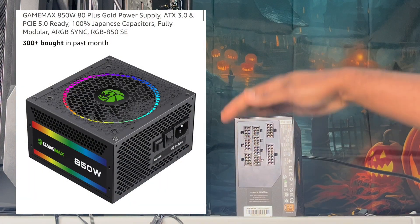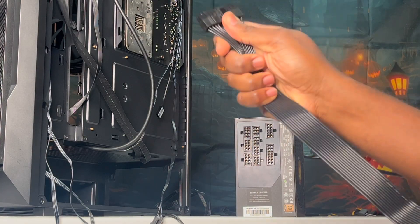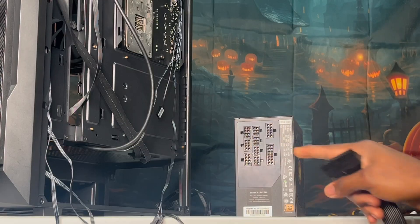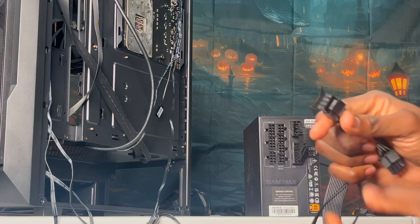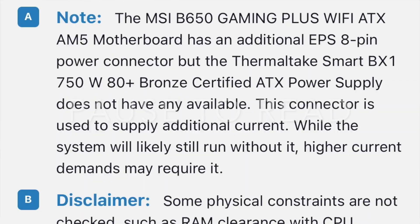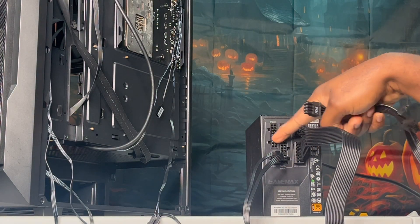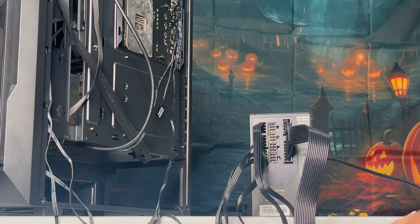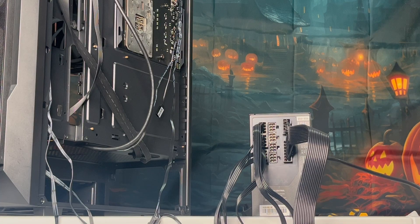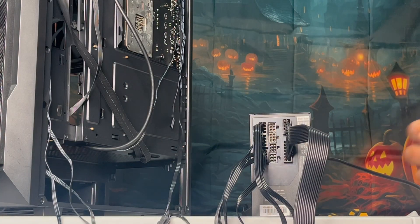Now we have the modular power supply. I know most of the cables that have to be plugged in. We have the motherboard 24-pin that goes into the motherboard, separated in two. Then we've got the CPU cable which gets plugged in right here — we will come back to this because I ran a build online and it gave me an issue with my CPU power. Now we've got our two PCIe cables — we're going to plug them both in to power the GPU. And last but not least, we have a SATA cable, and this is where I'm going to plug the case fans in because I don't have another solution.